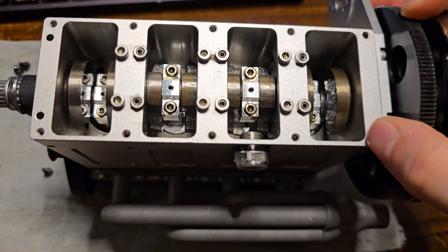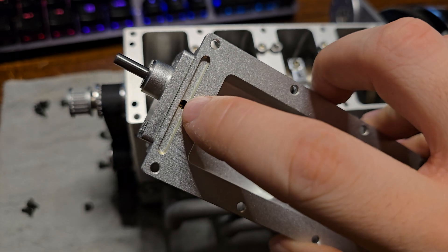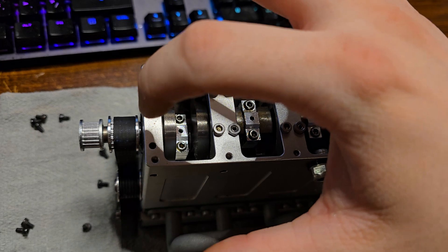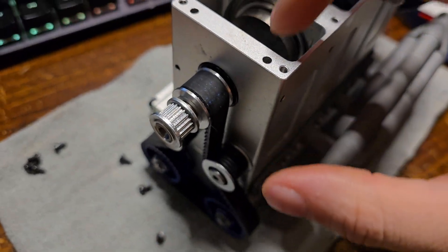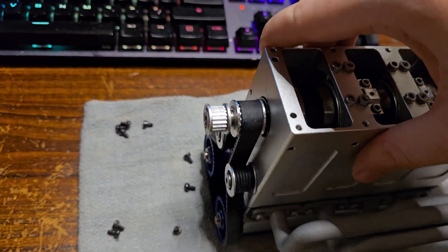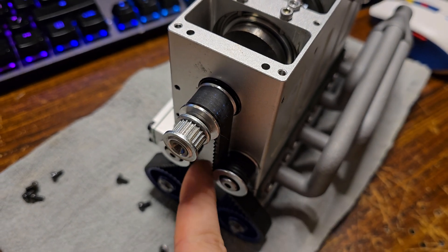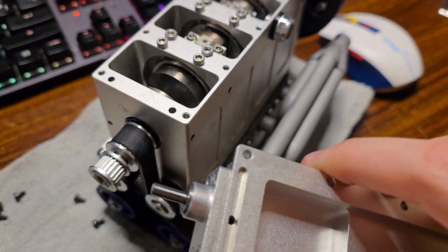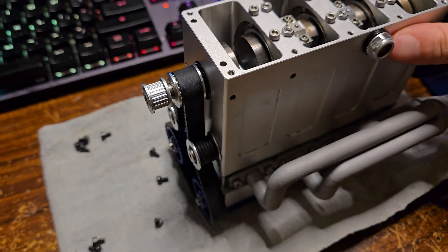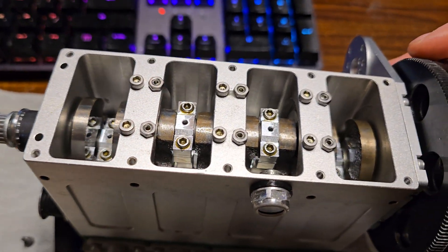I do wish they had updated it — it's just a single center hole. They could have center-holed it, looped it around the crank and then back up through the middle, so it just fills up the channel which then feeds both rocker arms. It would have saved a whole bunch of problems — well, not really problems, just things I would have changed if I'd designed it. But they did fantastic on this.